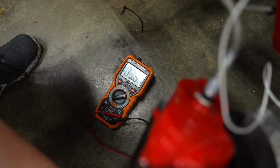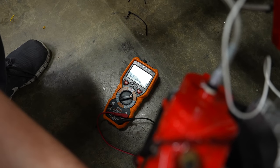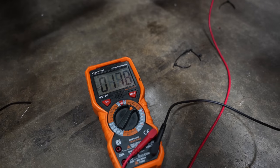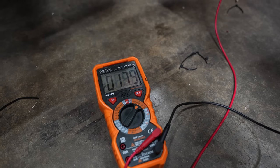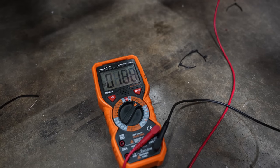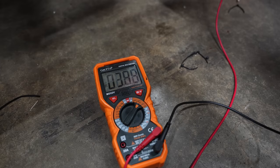Goes up to 3.5. Move the wheel a little bit more, 1.75. 3.5. What you're noticing is a low and a high value between 0 and 5 volts. Even though this is a 12 volt circuit, you're seeing 1.75 to 3.75, something like that, right? But it's consistently up and down. So that's giving you your on and off circuit.